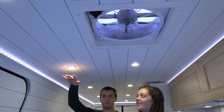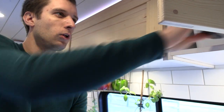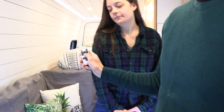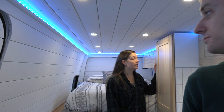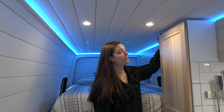Moving up to the ceiling — one of the things I'm actually the most proud of in this van is the lighting system. We got these adjustable dimmable LED lights that are controlled by a remote control. There are 10 of them on the ceiling, and when they're all on together they draw somewhere around 45 to 50 watts. I can adjust the brightness with the remote — on and off. Also up there, we have a 32-foot strip of color-changing LED lights that gives us a little accent light in whatever color we're in the mood for. Behind here, we can adjust the lighting in the bedroom area separately with a rocker switch hidden behind this cabinet. We do just have this light switch to turn them on and off to separate those areas.